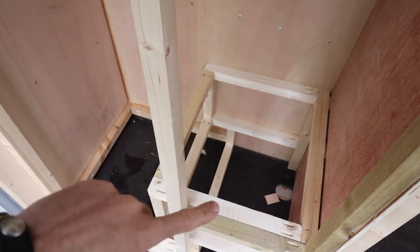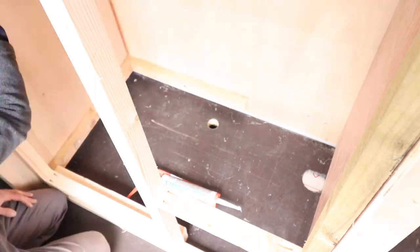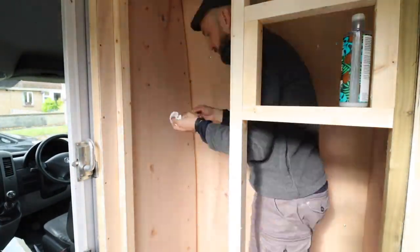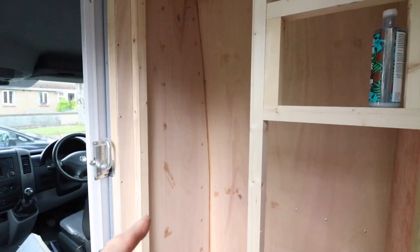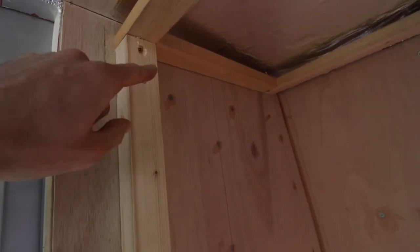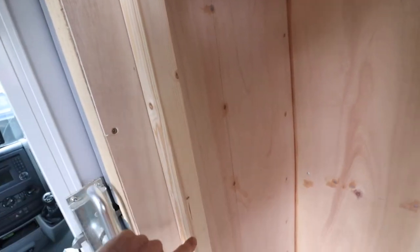The composting toilet is now taken out and I've filled all the screw holes with silicone to prevent them getting wet. The next thing is to secure this side batten — I've secured it with a screw going into the bulkhead and then a screw going in at an angle to hold down the top frame. I'm going to secure the rest of it to the bulkhead by running screws down along here.